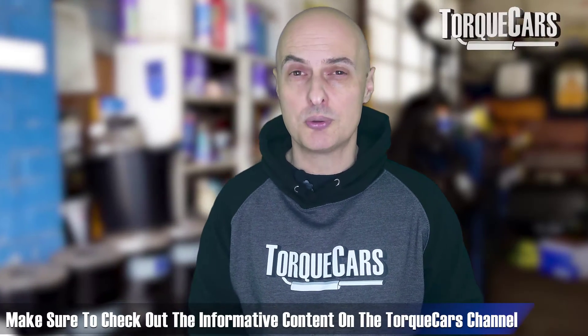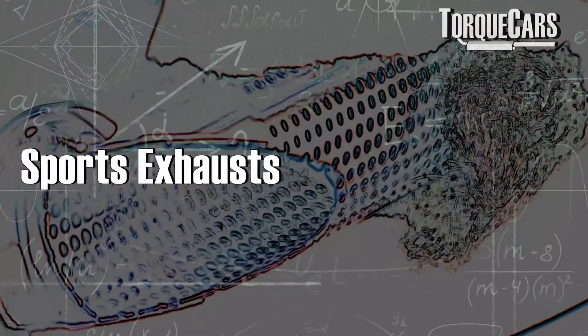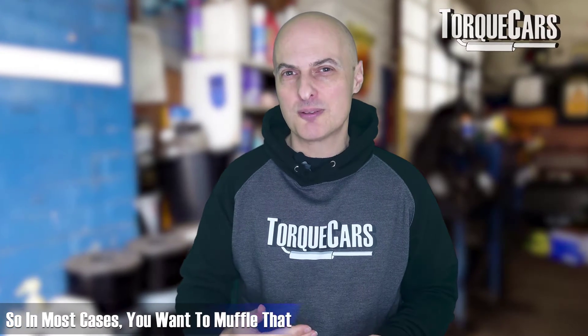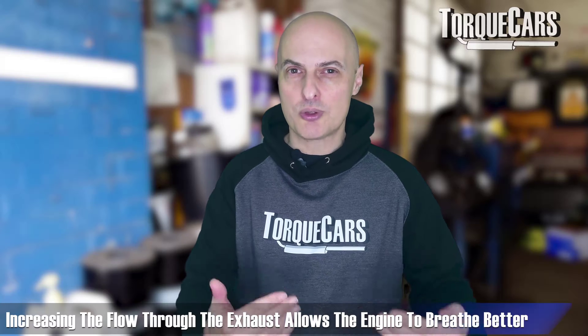If you're starting to see heat soak becoming a problem, look at intercooler upgrades — though bigger is not always better. On sports exhausts: on diesel engines, I never feel a sports exhaust adds much. The diesel exhaust note isn't fantastic, and in most cases you'd want to muffle it rather than amplify it. The benefits of a noisier sports exhaust are often outweighed by the inconvenience of driving a very drony car. Let me know what your experiences have been.